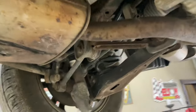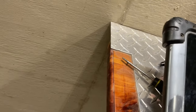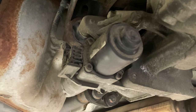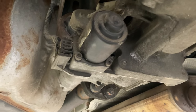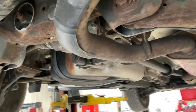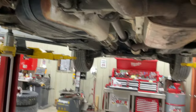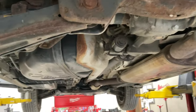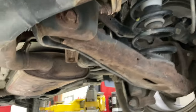I can activate that with the scanner — let me show you real quick. You can hear that motor trying to engage, still trying. There are no codes because it's satisfied that it's trying everything it can. But I can spin both rear tires and there's obviously no lock — because with the drive shaft in park, you shouldn't be able to spin those rear tires once that motor has locked that diff in.